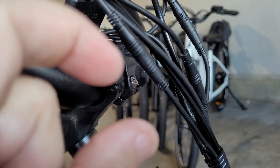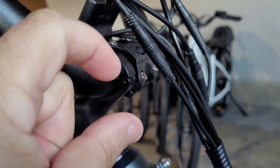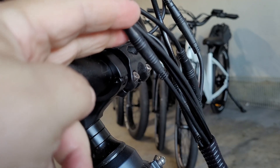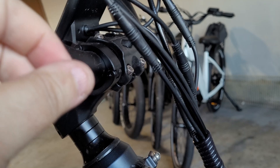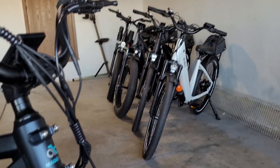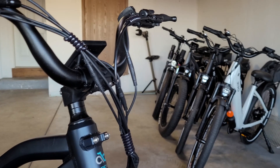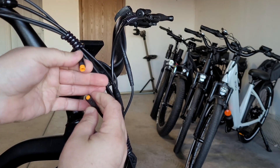When you're connecting these, you see these two arrows — that's how you want to line up the connectors when you connect it back. When taking it off, you don't want to twist these, because like I said they're just little pins and they're very sensitive to bending. You pretty much want to pull straight off. You're going to need two hands or two pliers — pull it apart, but no twisting. I'm going to set the camera down so I can use both hands to pull this off. It does take a little bit of time because it is on pretty good — it's really really tight with good reason because you want a good seal. There we go, got it off.